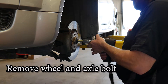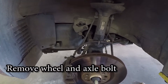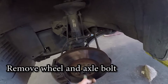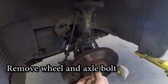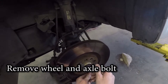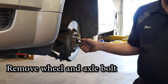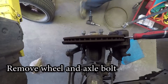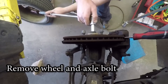The first thing we're going to do is take the axle bolt out. This can be very tight, so use of an impact or breaker bar is required. You have a couple of options: you can stick a lug bolt back in through the rotor into the hub and stick a screwdriver into the vent of the rotor, rest it up against a caliper bracket, and use a breaker bar. Or, before you pull the wheel off while the vehicle is still on the ground, you can use a breaker bar or an impact to loosen this up.